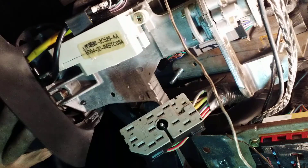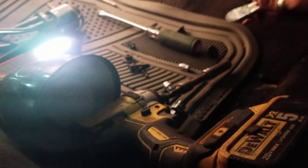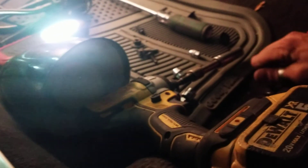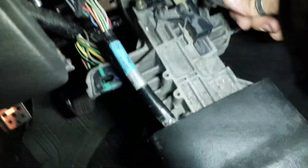So you drop the wheel — that's the fun part. I'm gonna break out the T15 Torx for this part. Now that the steering wheel is dropped, you don't have to have your fascia taken off; I just have mine off because I was working on my cluster. The wheel kind of shims down after that and you're able to access the top.